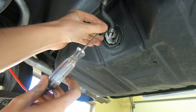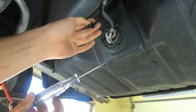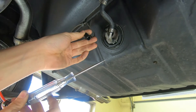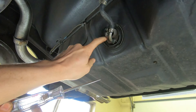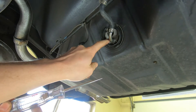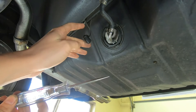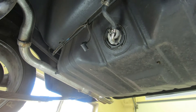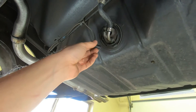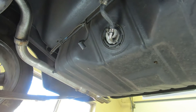What that means is my entire circuit is good. The constant voltage regulator on the back of the instrument cluster is good. Everything electrically is good. So the only thing left is this — the other possibility is the gauge itself. Now I'm going to show you how to test the gauge itself to see if the gauge is bad. Once we eliminate the gauge from the equation, the only thing left is the fuel level sender.